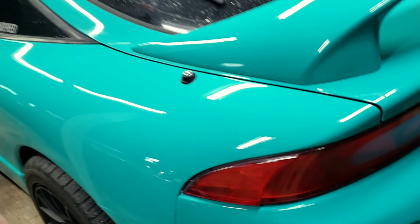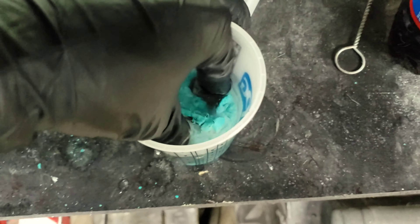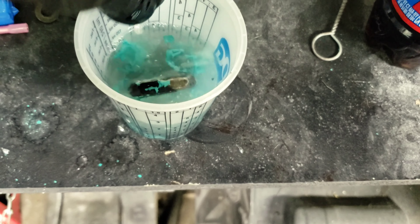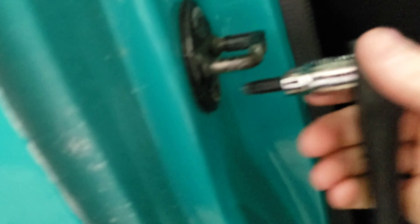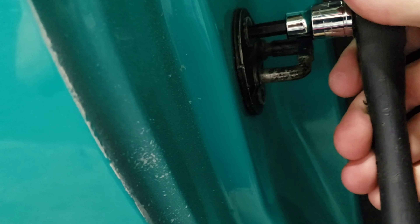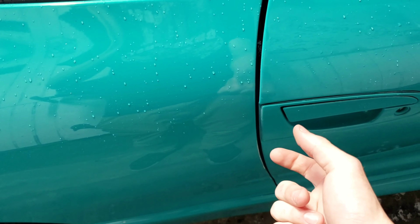I pushed the car outside and moved it back over here so I can get to the side a little bit better. First thing I'm gonna do is the other side - you can see this latch here. I'm gonna pull this off, soak it, clean it up, and put it back in. I got the brush out and brushed this stuff off. Fun fact: both doors shut ten times better now. I think the latch needed to be adjusted up a little bit, and that's what I did.